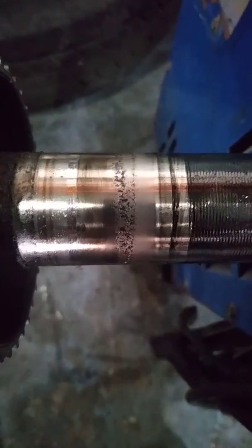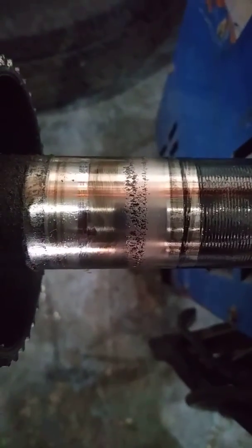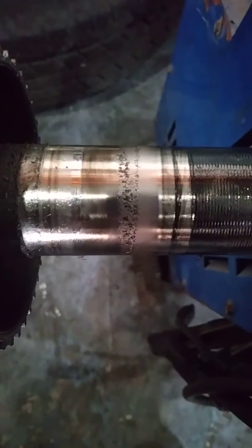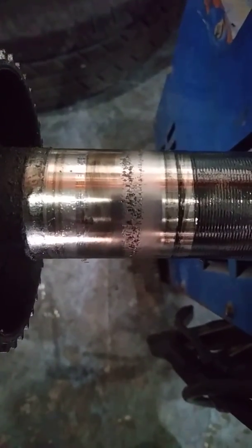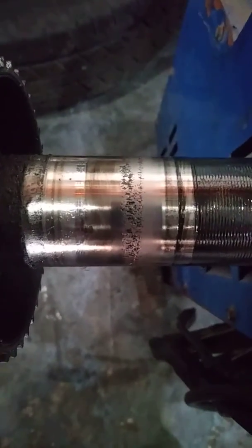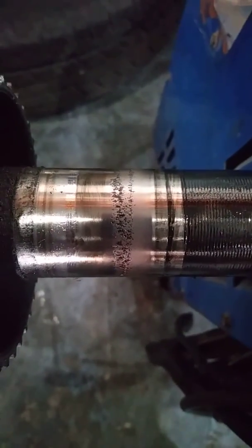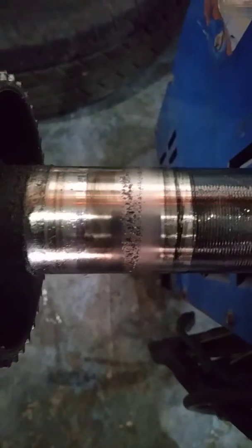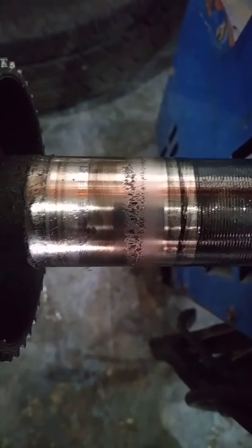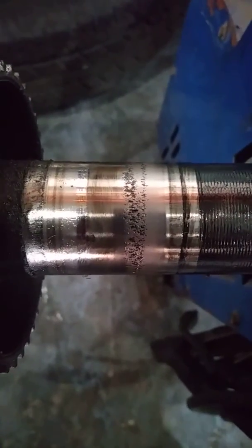The hardening had gone through on the axles around 200,000 miles. And the bearing surface had become rough, which is what was making the noise. So if you've got a truck, F-150, 200,000 miles, and you've got a wah wah wah noise coming from your rear, that's probably what's going on there. Probably you need new axle bearings and axles.